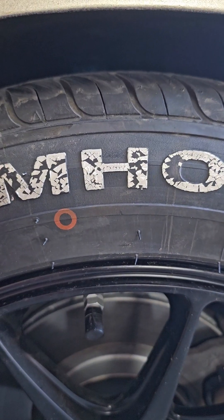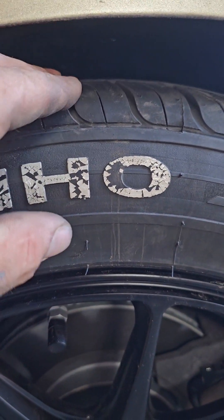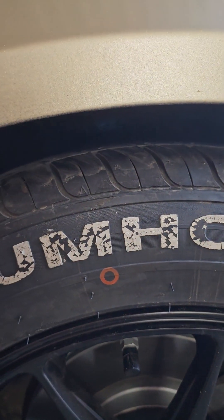I did only go an inch and three quarters, not two inches. I'm going to leave this here, let it settle in, and finish this video in a few days to see where it's actually sitting. After more research, the preload is basically: tighten it to where the spring is not going to be slopping on the shock, then do the measurement of your tool — four or five millimeters. Outside of that, your preload is not going to stiffen up your shock or spring per se — all you're doing is pulling that shock further out of the tube to keep the shock in place when you jack it up.